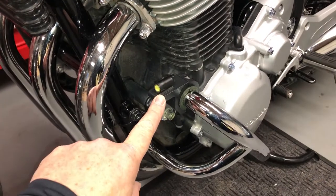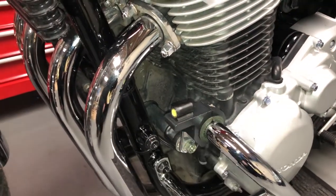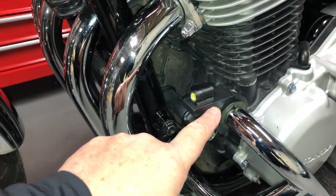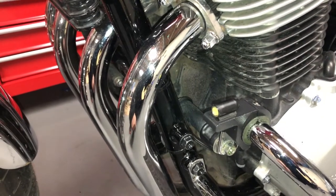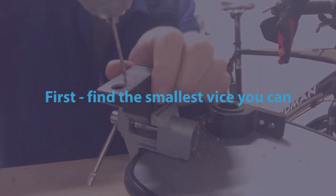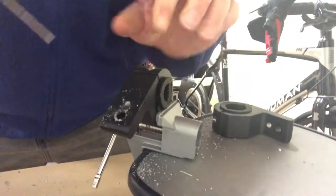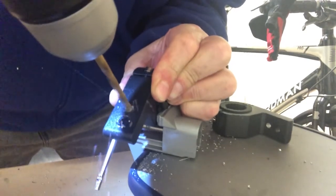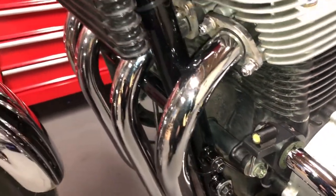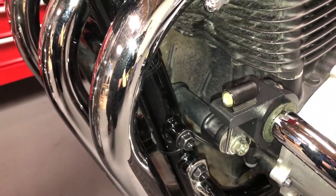So these are BikVis optional crash bar mounts or engine bar mounts, and they come with varying bits of rubber for different sizes of bars. They're really for their larger spots, but what I've done is I've drilled an extra hole in this top piece to take the cable from the bottom of the bullet LED. And mounted on there, because it's kind of hard on a naked bike to find somebody to fit these. So they've worked well. So that's the BikVis optional mounting brackets.